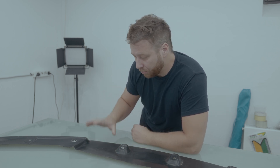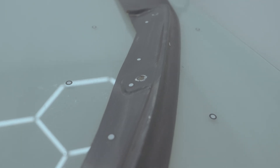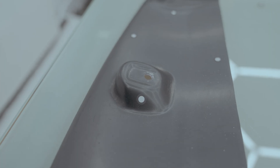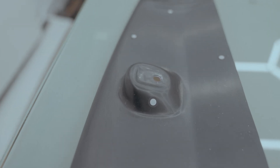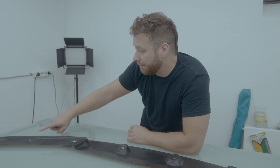So let's check out what this thing can do. The first project I've been waiting to do for ages is a custom front lip for the R34 GTR. For that, I will be scanning a stock-shaped lip — in this case the lip I got from Ukobu Factory in Japan — and will be using all the shapes and mounting holes as reference for our own. Without a 3D scanner, making a complex part like that would be near impossible, due to the way all the mounting holes are angled in different directions.